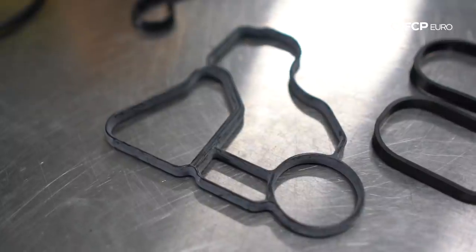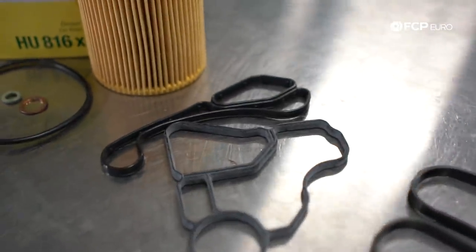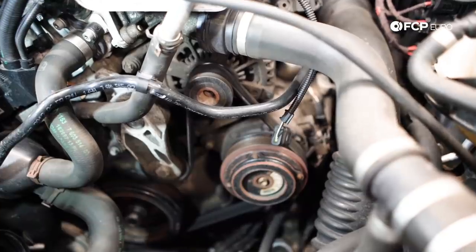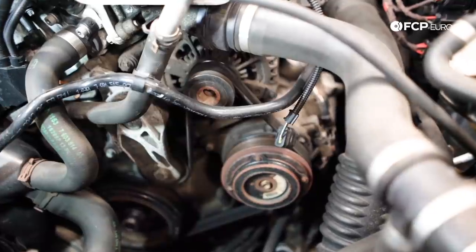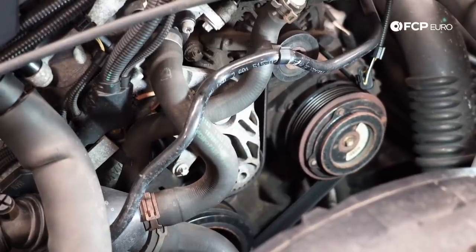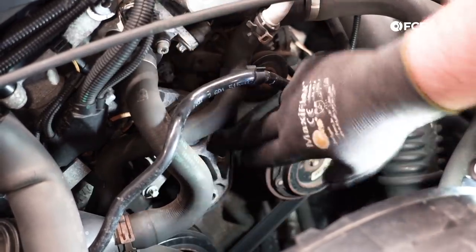Fortunately, on the N20 engines, it's not nearly as big of a problem as it would be on some of the N52, N54, N55 engines. Fortunately, the harmonic balancer design makes it impossible for the belt to get sandwiched between the harmonic balancer and the engine, therefore creating a problem in which the belt is ingested by the engine. But we've talked about that in other videos.